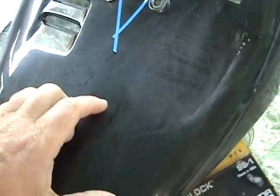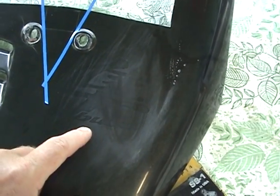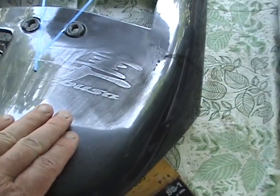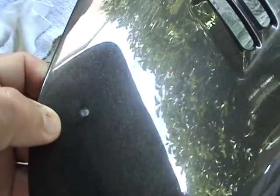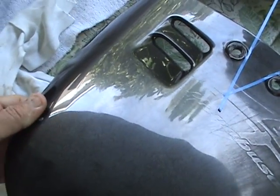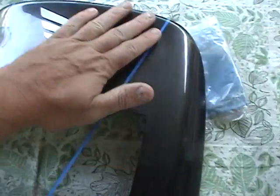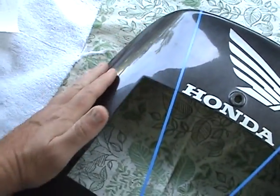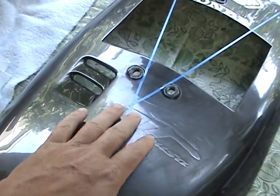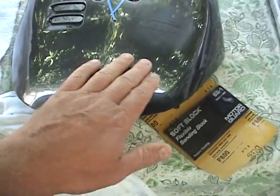The Hayabusa emblem is in Japanese so I can't read it, but it says 'boosa' right there. I have to get that smooth to where it's not visible — it'll show up in the finished paint. I also have a spot right here which is a rock chip. I should put a little spot putty on that. You want to take your hands — all your fingers and your palm — and rub them over the whole panel to feel for any ridge, bump, depression, or anything like that.